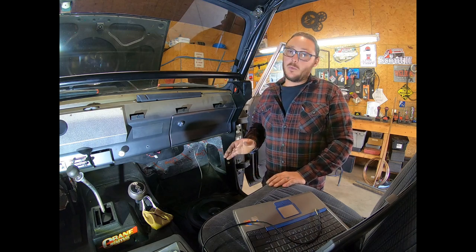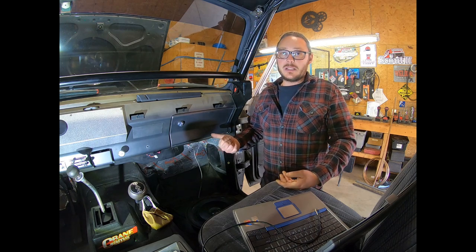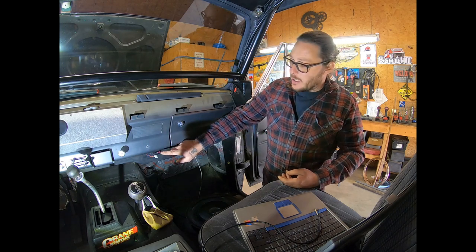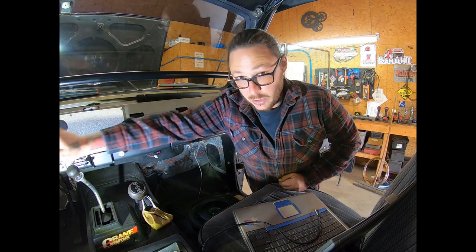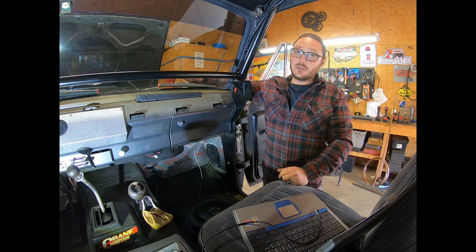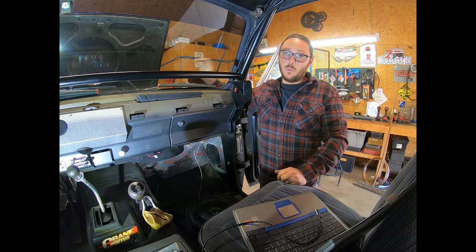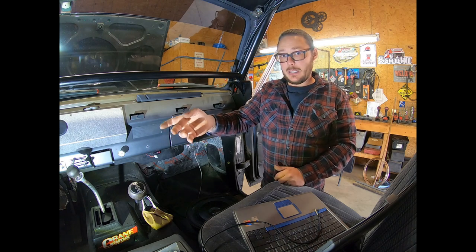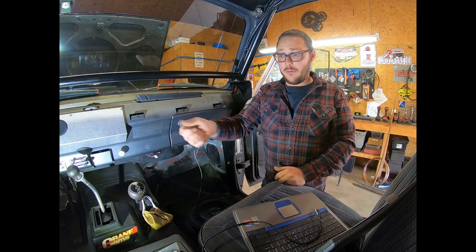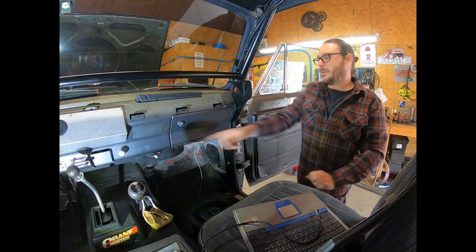That being said, what we're doing now, again, engine's been properly warmed up, timing's been set. We're going to put this thing in ALDL mode, which is done by jumpering pin A and B of your diagnostic connector. We're going to turn the key on, and we're going to feel to make sure that the IAC has actually driven closed. Once the IAC is driven closed, we're going to unplug it. We're going to come back into the vehicle, turn the key off again, and then disconnect our connector. So follow with me. Key on, our jumper's in place.